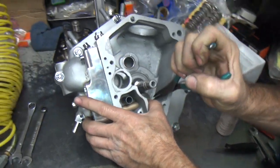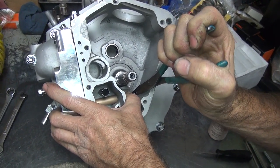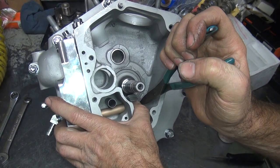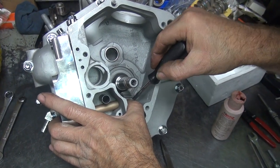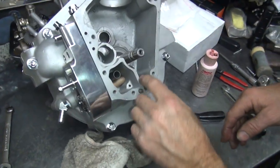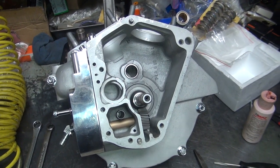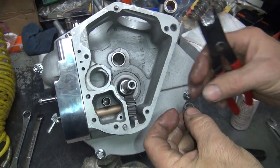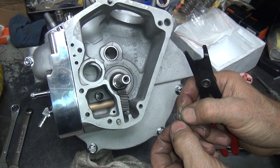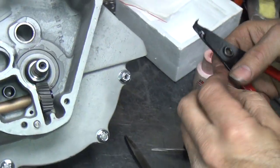It appears the oil pump shaft might have a burr on it, because I didn't think about checking it for that. It usually isn't a problem. It appears if there was a burr, it's gone — more likely I just misaligned and didn't have it right. But it sounds better when it's their fault. Now you take the gear and rotate it until the keyway is on the back side, because you want this clip to go in there with the key on the back side, not the front side where the groove is. Notice that somebody accidentally bent the clip overlapped.